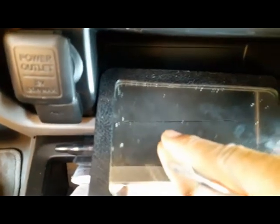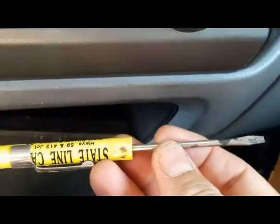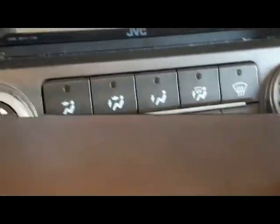After you've got that out, I'm going to use a mirror. You can see the plate right there with two slots — one on this side and one on this side. What you do is put a small screwdriver into that slot and pry it, and both of these slots should come out. I'm using a small screwdriver so it fits into that slot. I put it in the slot, turn the screwdriver, and that thing pops out. I do the same with the other one — put it in the slot, turn it, and it pops out.